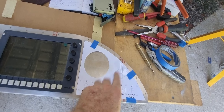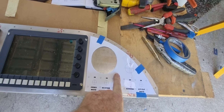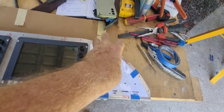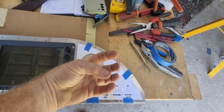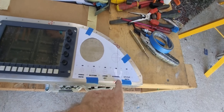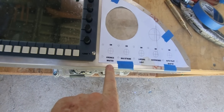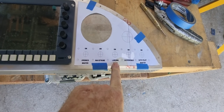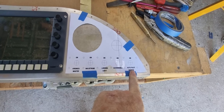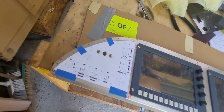What I'm relying on to hold the perspex against the instrument panel in its correct location will be one, two, three, four plate nuts inserted into the aluminium, then face-fixed through the VX16 radio to hold it all in spot. There's also a rather large washer - a screwed-type washer - on the back of the 12-volt display which will hold the whole lot together. I don't have to rely on each of the toggle guards or toggles; I'll just make those holes oversized in the aluminium. Working from left to right: avionics master, nav strobe, landing light - I'm yet to work out how I'll integrate the wigwag accessories I have here - and autopilot master.